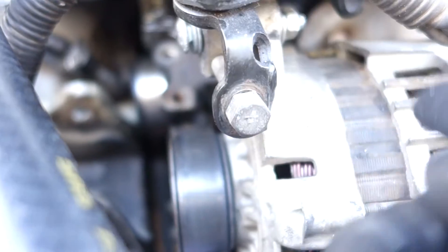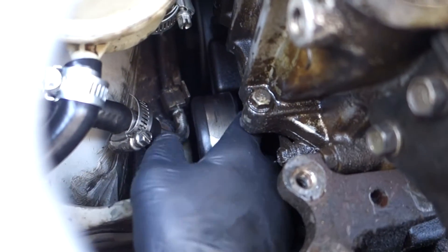I removed tension off the alternator. The thread stripped out right there so I put a nut and bolt there to cinch it up after it's tight. I'm making progress - I may have to undo this right here so I can move this line over. I'm so close to having it off.